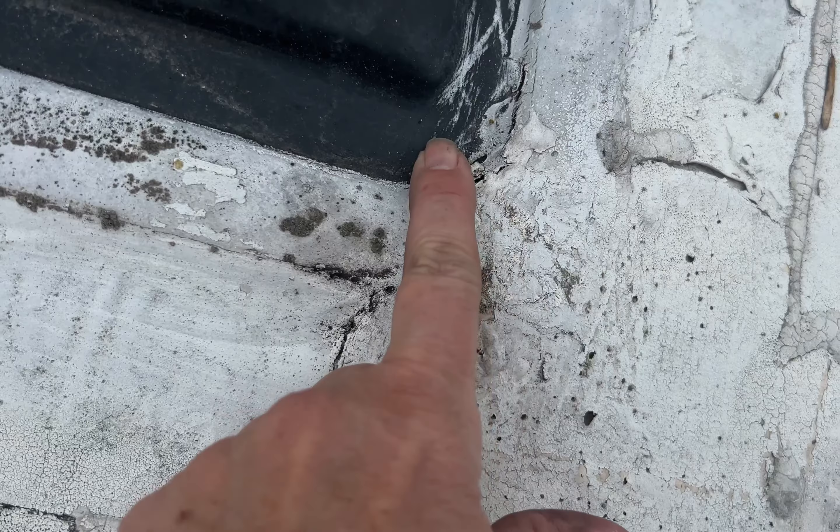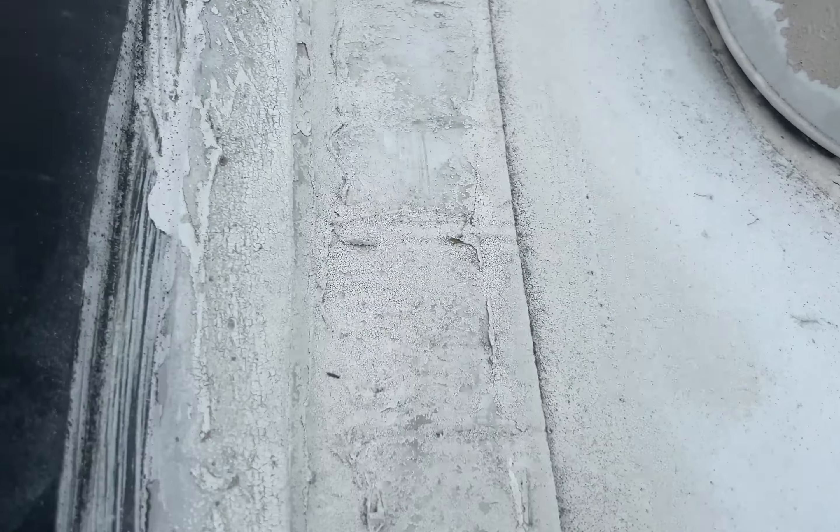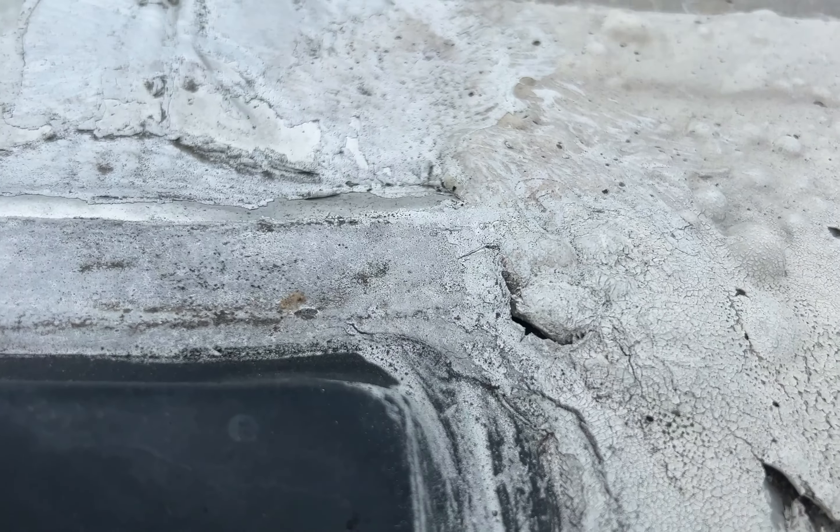While you're on the roof you're also going to check the sealant. It's really important when you start every season — I would do it a couple times a year, especially depending on the area you are. If you're storing your RV for the winter with a cover on it, you can do that check once a year. But if you're living somewhere like Arizona where you have sun exposure all the time, get on that roof twice a year, even more, and look at the sealant to make sure there are no cracks and holes in it.